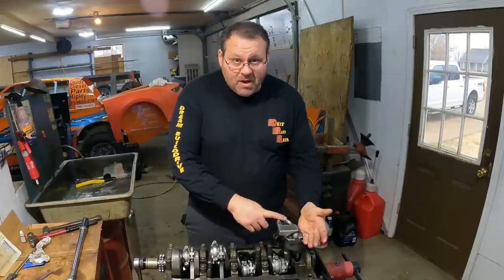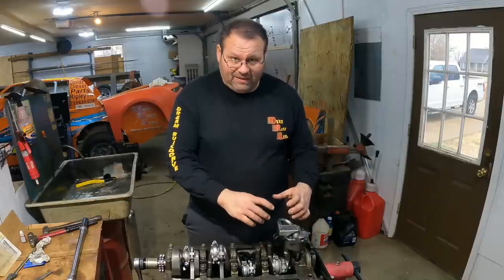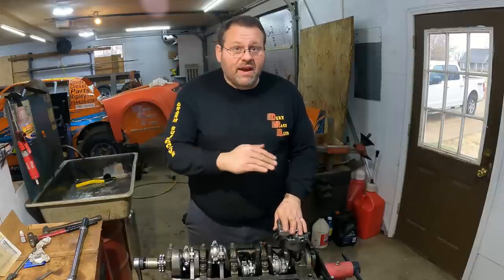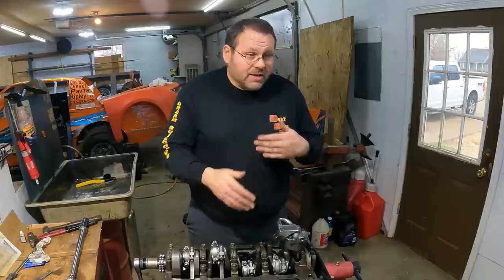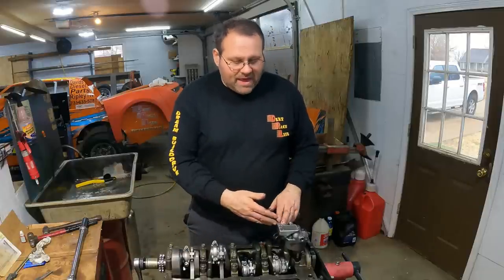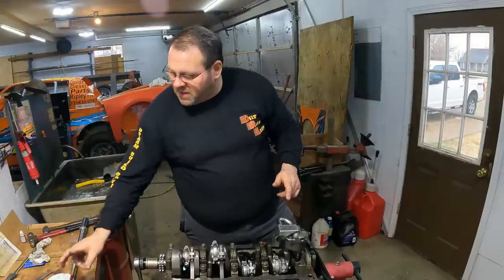Because these different pumps, according to which pump you use, do actually have a different height. It varies. Look them up in the catalog. It will vary pump to pump, so you can change which pump you're using in some cases to probably fix a problem you've got with that. But you've got to pay attention to it, y'all. Hang on, one more thing.